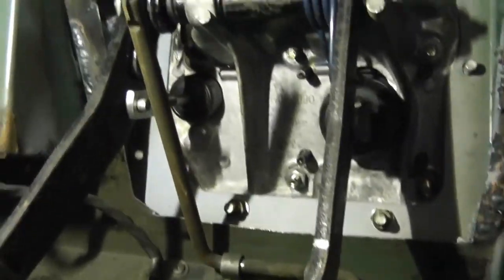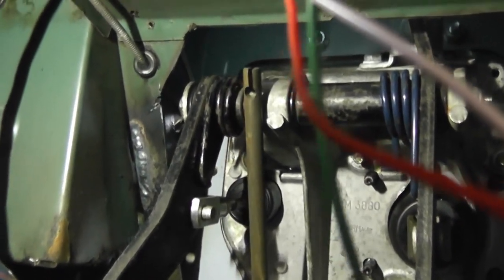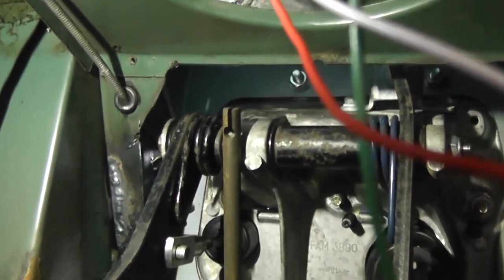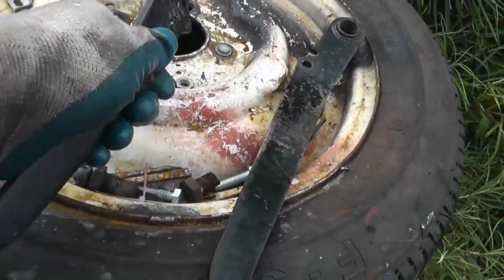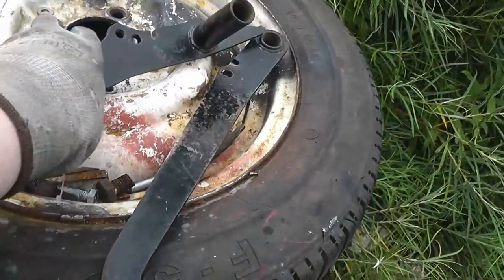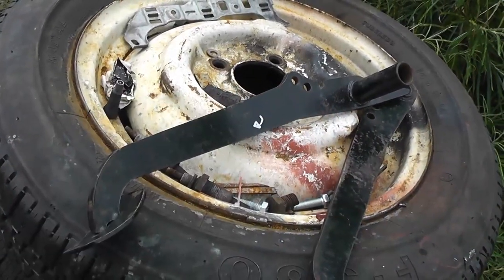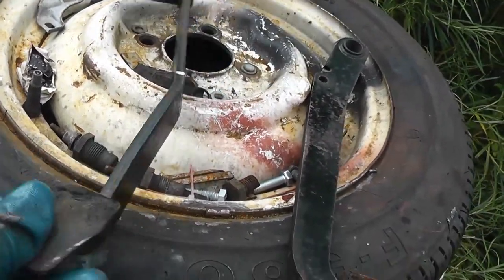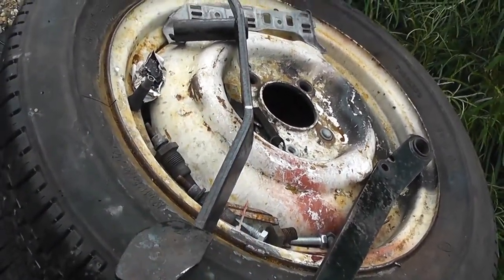So now inside the car, you can see the problem with the throttle pedal. If I grab the throttle pedal and try and lift it up, see, it fouls on the crossbar for the new pedals. So I've taken the pedal box off the car again and taken it apart to get the pedals off, because I'm now going to strip these down by brush wheel, and not only give them a nice new coat of paint, but also remove the pedal pads and re-weld them on so that they are at the correct angle.